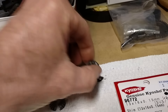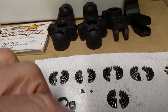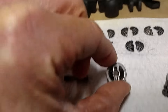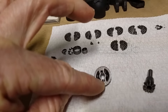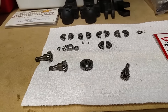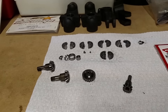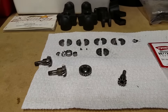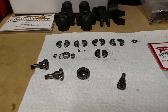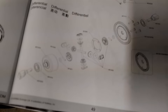Here's a picture of a good one. When these fail, they all fail pretty much in the same spot — right where the pin goes through the gear. One way to discourage your diff from imploding, especially if you're going to run on 6S or gear your car up and bash hard, is to definitely get some extra shims in your diff.